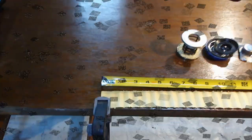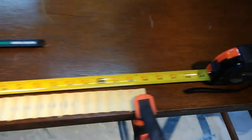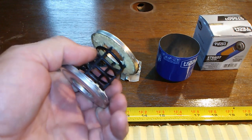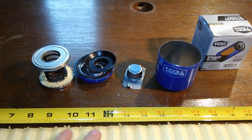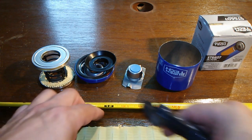Let's cut this open and see how long she is. Here she is all spread out — she's 38 and three-quarters of an inch. It's got a plastic inner cage, but it's all put together pretty well. In a pinch I would use this filter, it's pretty good. The only concern is the micron rating — 30 microns or higher at 99% — it's not too bad, but it's not the best. Though it is only a three dollar filter, so take that for what it's worth.